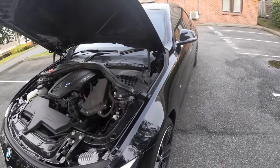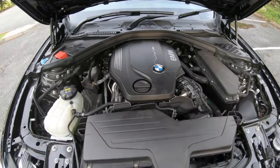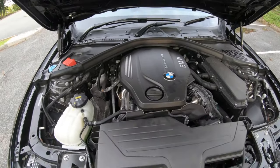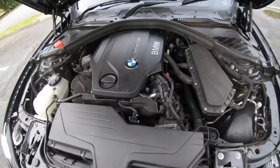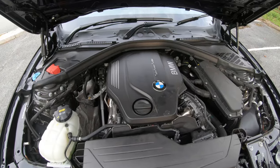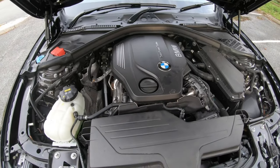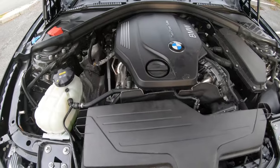There's always a way around it. These cars are now completely computerized - every single component I can see is running with a sensor. They will have problems with the turbos, definitely with the actuators because they're electronic, and with the EGR - that's just the way it goes later in life. If you're going to use it for short trips, go and buy a petrol car, not a diesel. These cars need to be driven for quite a few miles to let the DPF regeneration occur - pottering around town destroys these cars and does them no good whatsoever.